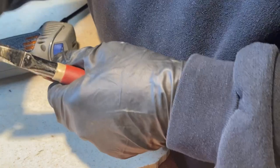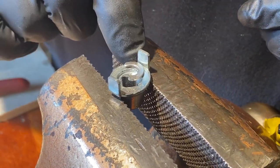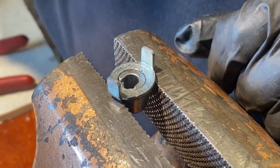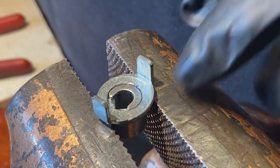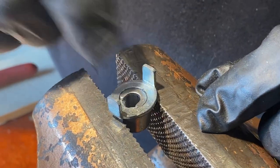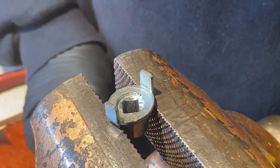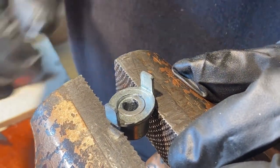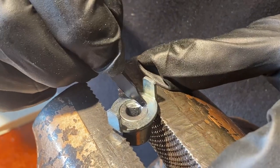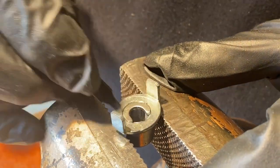It's going to take just ever such a small amount off. I'd rather try this over and over a couple of times, because when we're pushing the spider back on its spring we can slide this on the shaft and see how it fell right into that hole. That'll hold everything on there. That C-clip can't come out because it's trapped in that little indentation. I'm going to try a different position — it should just fall in, that's what we want. Now you won't have a little bunch of struggle. I should be able to even turn this around in there and it fits nicely. A little tight right there, so it could be the casting.